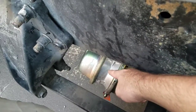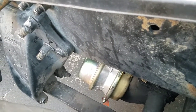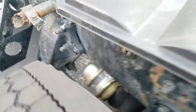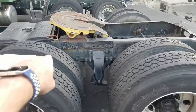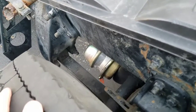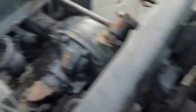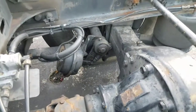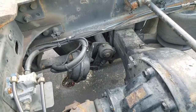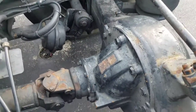Right down there is your park brake chamber. It also includes the service brakes, but this one is on the forward drive axle. You've got the forward drive axle and the rear drive axle. When the park brake is applied, the forward drive axle will not turn. Coming around here, right there you can see your service brake chamber — when you hit the brakes. There's one on all the tires and one on the steer axle also.